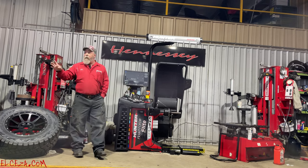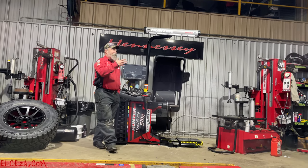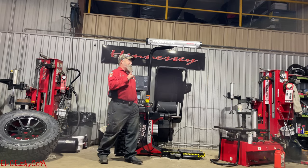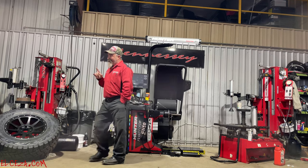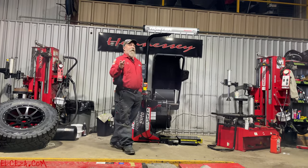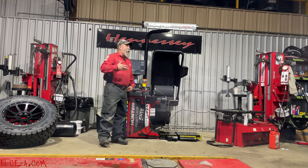Okay? I know y'all probably don't do a lot of rotations in here, but I get a lot of stories that go, what if it puts the tires back in the same spot? Guys, that's never going to happen. Why? Because which tires do the most work on a Corvette? Assuming they drive it, not normally. Assuming they don't burn the tires off every time they start and stop. If they just putter around with it, if it's their midlife crisis, if we're not hot-rodding up and down the road, which tires do the most work? Front tires, right? They're doing all the turning, all the camber roll. So those tires are going to what? They're going to wear more rubber off. When it comes time for rotation, I promise you those are not going to go back on the front. They're going to go to the rear because they're going to take more weight than the rear tires.